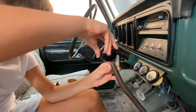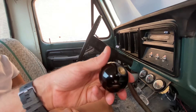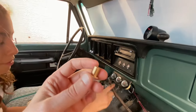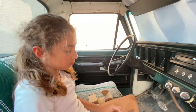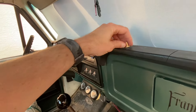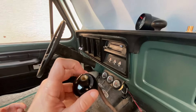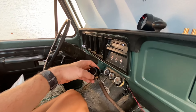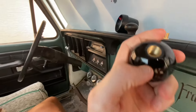Kind of doesn't look like it's fitting. I think our threads are off. This is probably the problem - this is a normal size but that's just the problem. We're dealing with an F250 and these threads don't match up. I saw the kit and thought one of them would work. I think what I'll do is get a threaded adapter that fits on here. I'll figure out what thread size that is and bring this with me to find one.